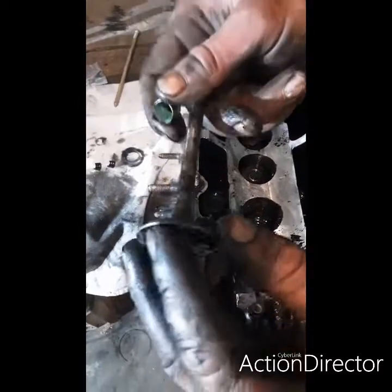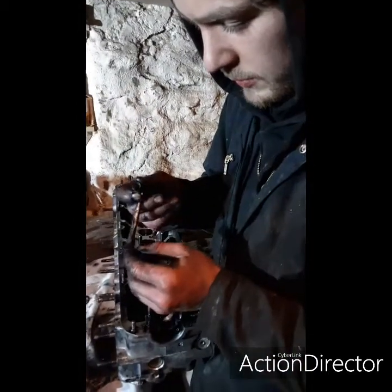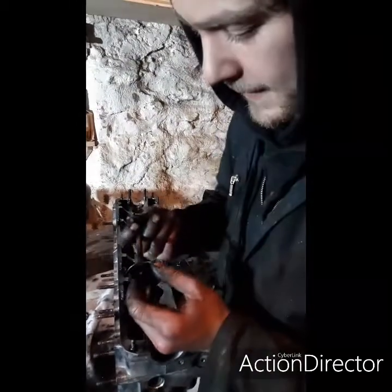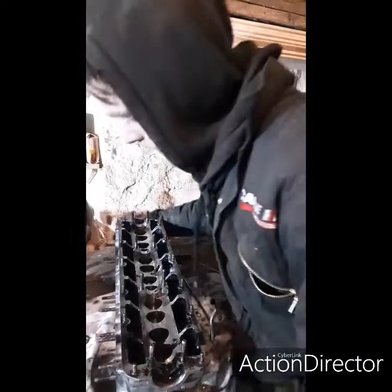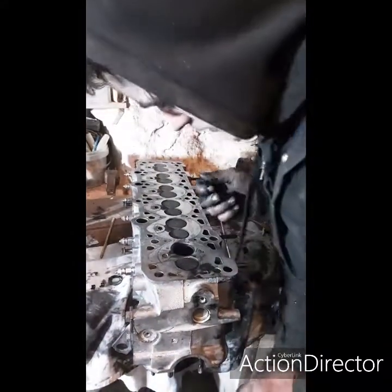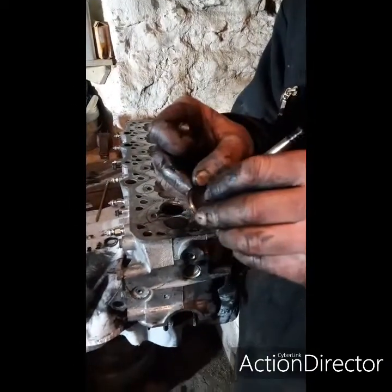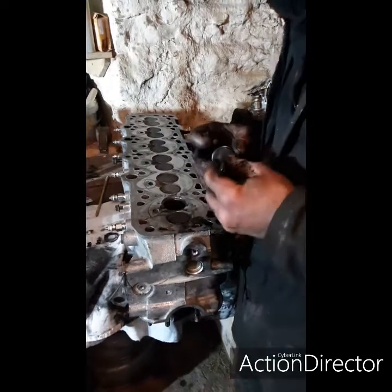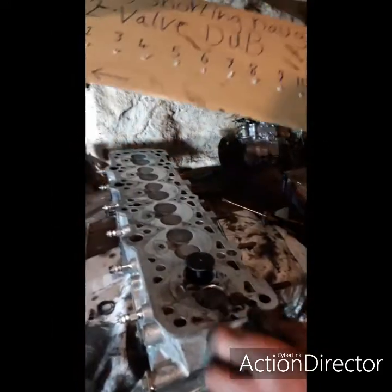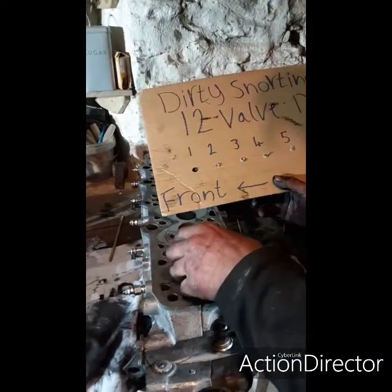So look at that dirty 12 valve. So you can actually see there's quite a bit more wear than I possibly wanted on there. Ah, that's not good. So if we tip it over, yeah, so it's sort of slightly rounded. Can you see on the angle where there's a little bevel on it? So that's what we want to grind off, really. So that's where it comes when you can count to 12. If you can't, then I don't know. Maybe just start with a 4-cylinder.